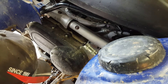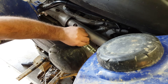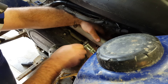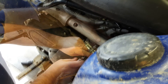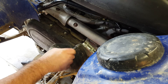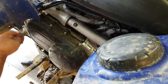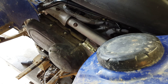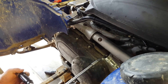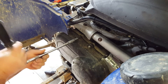Putting these kind of covers back on again is really so much easier if you just put them all in loosely to start off with, because you can jiggle the whole thing around a little bit. And then when you've finished putting them all in, just go around and tighten them all up together. So all of these bolts are 10 Newton meters tightness. There was no sealant on that rubber gasket — it just goes on dry.